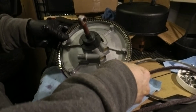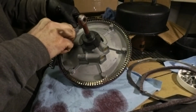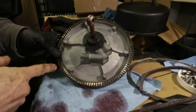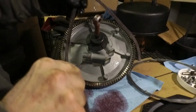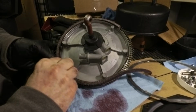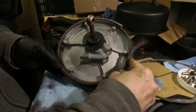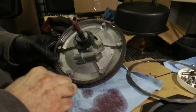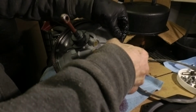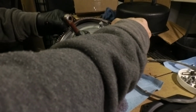Okay, so this expander ring, when you put it in, where the expander ring is oriented here, the felt ring, the overlap is opposite of where the expander ring was. So we're going to make sure that's 180 degrees out of phase. There we go. And yeah, I can feel the tension the expander ring has on the leather seal in here.